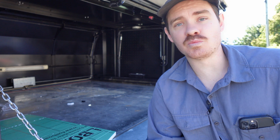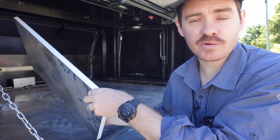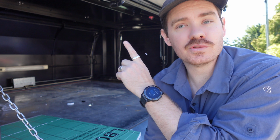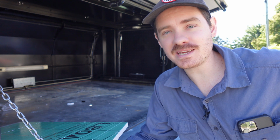Now we could actually even improve this because insulation works better if you've got the canopy, then an air gap, and then the foil board. But obviously, being a canopy, we're gonna put this foil board straight up into the canopy. We're actually gonna be using 20 mil for the roof, and then for the doors, we're gonna be using 15 mil, I believe. If that's wrong, I'll correct it below. Today, we're gonna do the 2 doors and the roof, and I reckon this 75 canopy is going to look unreal. Let's get to it.